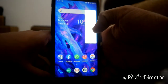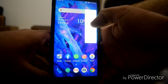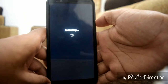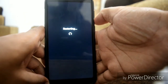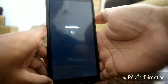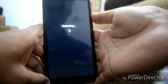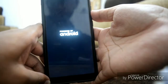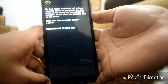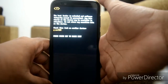After downloading, boot into TWRP. I have TWRP 3.3.1 installed. Click on restart and hold down the volume down button as your phone is rebooting. Once you feel the vibration on startup, let go of the volume down button and wait for TWRP to load up.